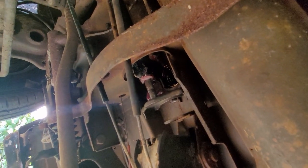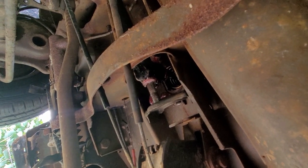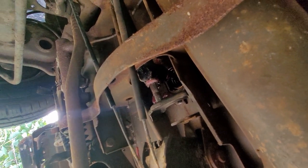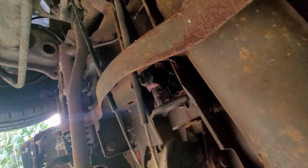Here's the mid coupler that connects the front shift rod to the back shift rod. The front one goes up to the stick and the back one goes to the transmission. I haven't put the wire back in yet because I'm still working on it, but that's where it is. You've got to loosen that up, then you have to turn the front shift rod on its side in order to release it. You can see here where I put it back in, and you can see the red grease there. The bushing on this one is a little bit interesting — it's not like the others I've seen on YouTube; it actually goes inside the shift rod.